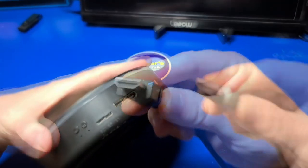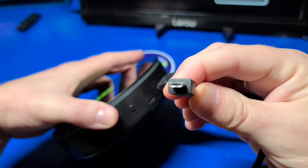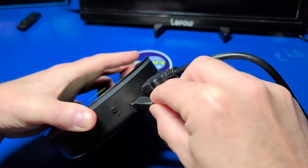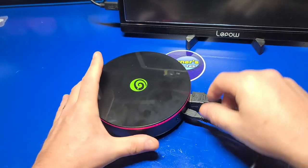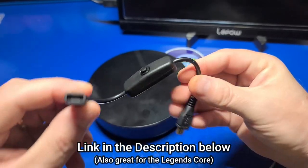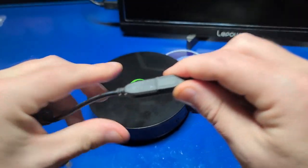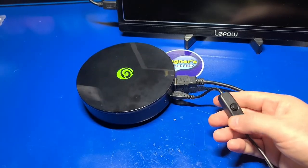Now let's go ahead and get everything connected. First off, we'll plug in the HDMI cable, then the micro USB cable for power. There is no power switch, which is an unfortunate omission, although there is a very simple solution. I picked up this micro USB on/off switch from Amazon for about $5 — connect the female end to the power cable and the male end into the Legends Core Max, and the problem is solved.